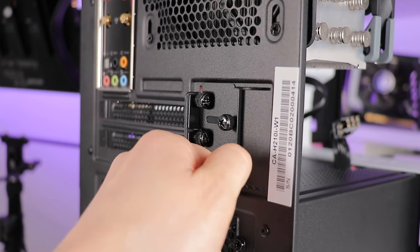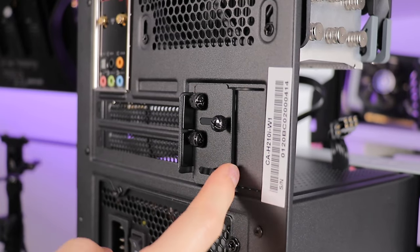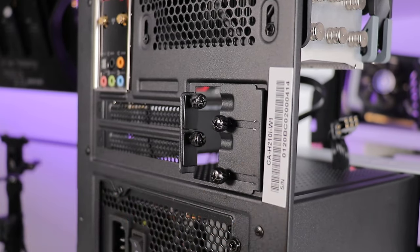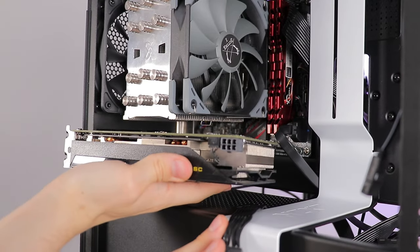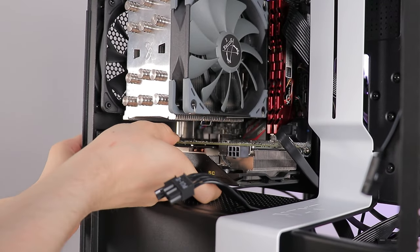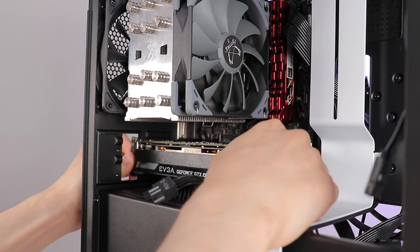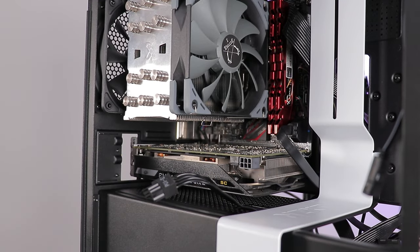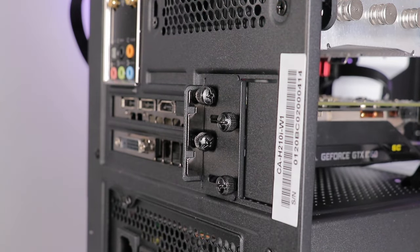Motherboard support for this case is limited to ITX boards. Graphics card-wise, the install is about as average as can be. The rear plate is a little fiddly, but it's a one-time thing. You've got plenty of space for pretty much any card you want with just shy of 290mm of length clearance and nearly 170mm of width clearance — though manufacturers regard that bit as height. You could push to squeeze a 50mm thick card in here, but it'll be resting on the basement shroud, and with an ATX PSU it'll be mostly blocked off. Not recommended.